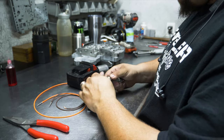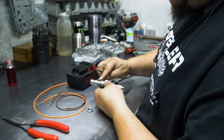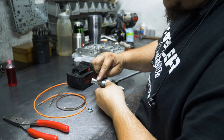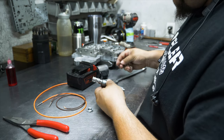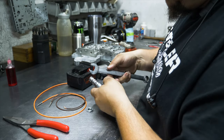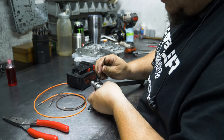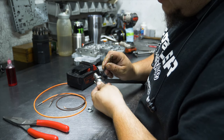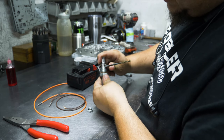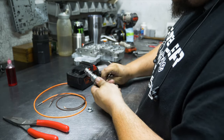So this just unthreads. The problem that I had was this was on there really tight and it was green Loctited, and this is a really hard surface, so you can't really grip it with pliers, and you also can't mess up these lands because it's a sealing surface. So this is what I came up with. I drilled a hole in my wrench and slipped the wrench over it. Then I was able to put my drill bit in there and catch a hole, and that gave me the traction that I needed to be able to turn that thing off. So once I got that off,